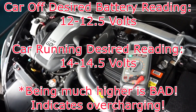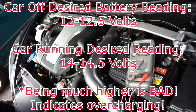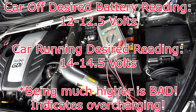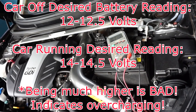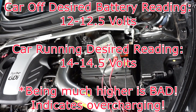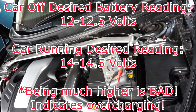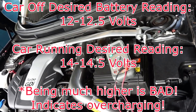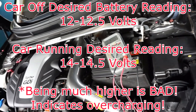Actually, that's a little off. Usually it's anywhere between 12.4 to 12.55, as you're going to see right now. When the car is on and the alternator is healthy, and the battery being healthy, the voltage should spike up by about two — so 14.45 to 14.55 — which will demonstrate a healthy battery and charging system.